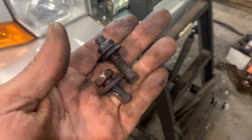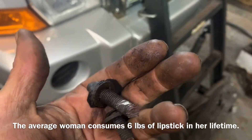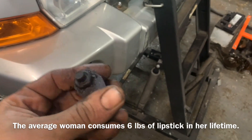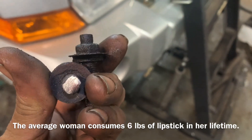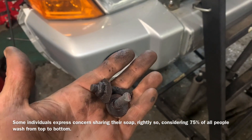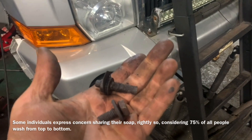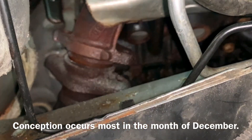As we can tell, that's pretty rusty and it would have never come out of there. We're going to end up replacing both of these — hopefully we can find one with the little tab on it, maybe a little bit thicker than that thin stuff, and it'll hold up for a while. At the very least, now that we have access through the fender well, it won't be so hard to put a nut and bolt on there. We got them out of there, so now this head or engine can come out, or you can repair the exhaust — whatever it is you're trying to do.